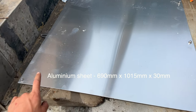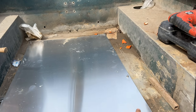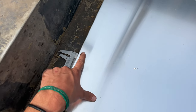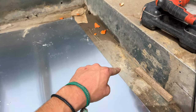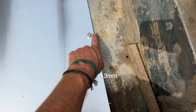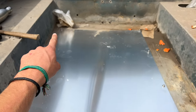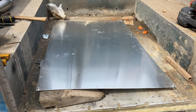The first thing you need is an aluminum sheet. The idea is to make four holes here and four holes here of five millimeter. I did them 33 centimeters apart — that's where the holes of the Sunwear panels are. The difference here is 1.3 centimeters from the edge to the pin, and same here 1.3 and 1.3. So just eight holes are sufficient, because you have to make holes on the side — you can't make holes in the middle.